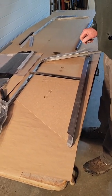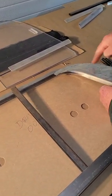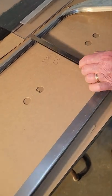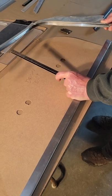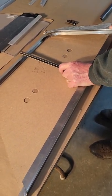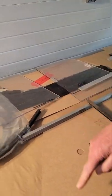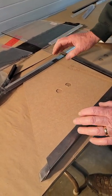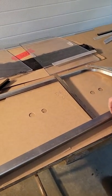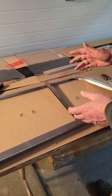I just watched my video and wanted to mention a couple of other things I omitted. When this has been made, trimmed, assembled, capped off at the front, and the bottom frame is all put together and welded, these two pieces will get upholstered separately. At this point it's ready to fit the side windows into the frame. The front window is made slightly undersized to fit inside the framework; the back window is made quite a bit undersized to allow for the track at the top and the track at the bottom, because they take up some room.